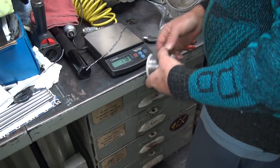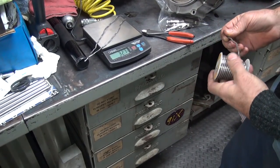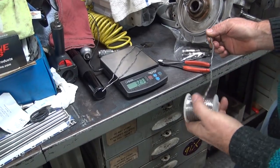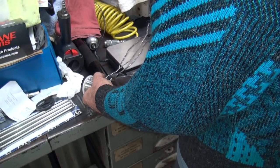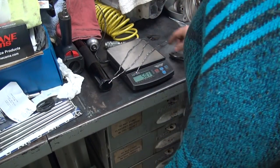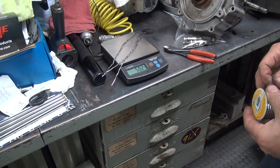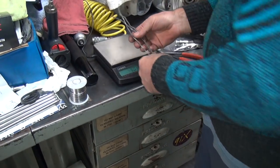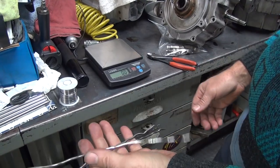That's 17, that's a little bit too much. Well, we do need to be higher, like we need 18. Or maybe just a tick further. Yeah, I'll make it the same. A little short ain't gonna hurt. Be about 49. Nope, there's 50. Close, right there. So that should be roughly 2 ounces. So that's how much we got to put on the wheel.